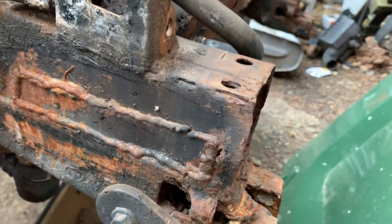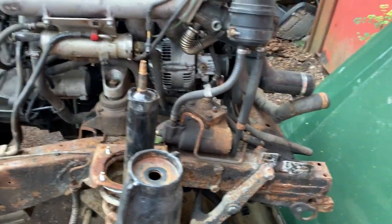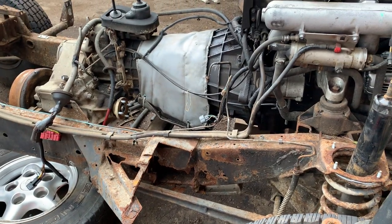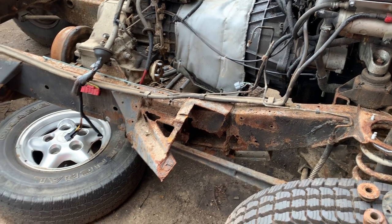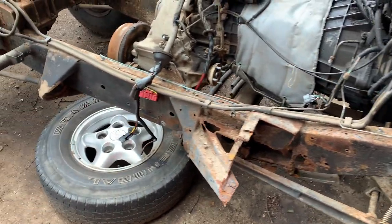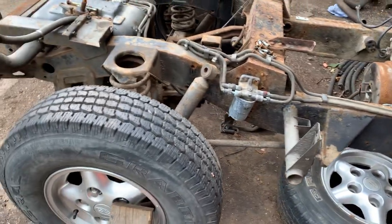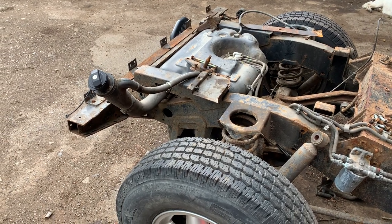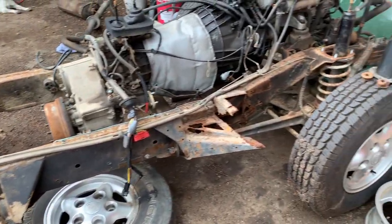We'll work around to the front dumb iron there. Especially if, as with this one, it's been in the sea. My advice would be: don't buy a Defender that you know has been used to pull boats in and out of the water, especially at the front end, because as we found with this chassis it's basically scrap. That's why this one's having a full galvanized chassis replacement, which should be done relatively soon. It's a shame really — around the back end it's actually really quite solid. But it's pointless putting a whole new crossmember and extensions on if the rest of the chassis isn't up to scratch, and this one most definitely wasn't.